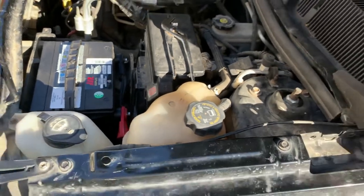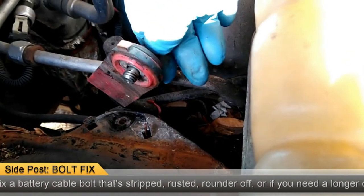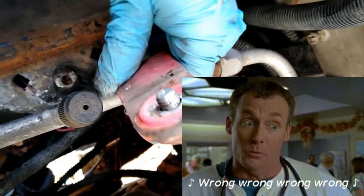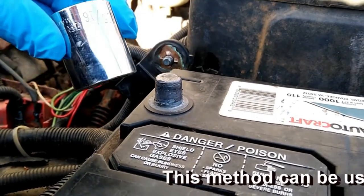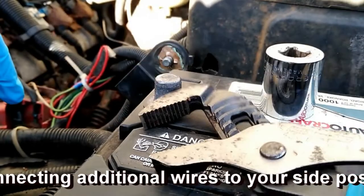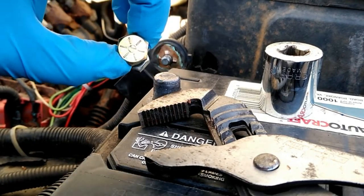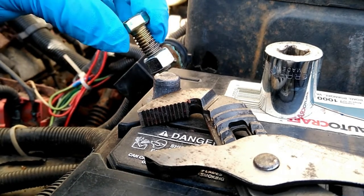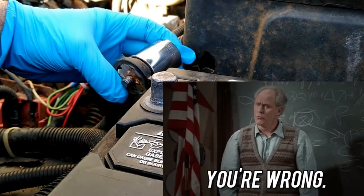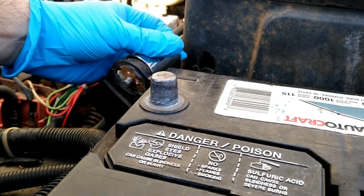But after that we're good to go. You can see this is your typical Chevy battery cable, so it comes with this side post terminal. Look like that from the front and this from the back. You're going to need something like a socket — this is a 15/16ths standard socket. And some channel locks. And then a regular 3/8ths coarse thread bolt — standard size that a 9/16ths socket would fit on — and a nut. So it's nothing complicated. Here's how we're going to take care of it. I'm going to use a 15/16ths socket, or a 1-inch socket if you have one. Just put it on the back side there where the plastic is, so that you're not blocking the head of that battery terminal bolt.